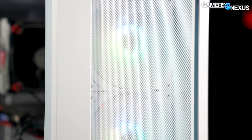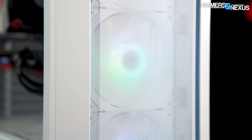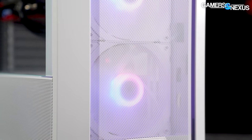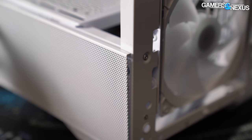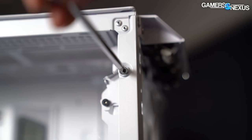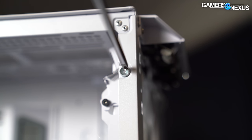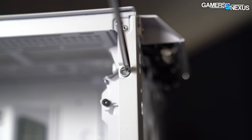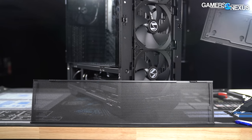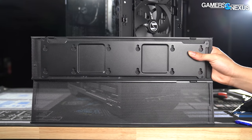There are several reasons to remove the front panel — swapping fans, removing lower side panels, or general access. The fans are seated further back in their stock position, which should help airflow in theory and also provides a more diffuse lighting look, giving a wider spread and making it look less concentrated on singular LEDs. Lian Li has also taken steps to protect the magnets from chipping — a problem with the original Lancool 2 — with all magnets now inset and fixed with screws. The lower side panels are fully ventilated with mesh to provide airflow to the fan mounts on top of the power supply shroud.